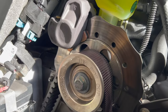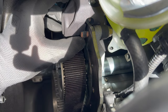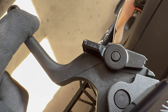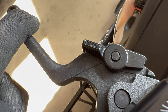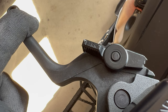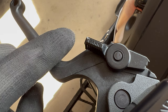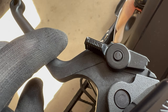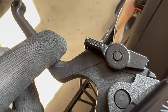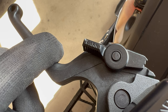Let's take a look at the brake system on my sled. When I'm not pulling the brake lever, there is no pressure on the brake pads — they can be moved around easily. That's how far I have to move the brake lever before it makes contact with the brake pads. All of this motion, you're not actually doing any braking. That tells me my brake system is functioning properly. If you keep your finger over the brake lever, just resting it there should not engage the brakes — you have to move it this far for the switch to be activated.